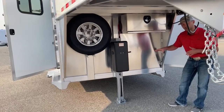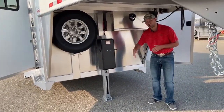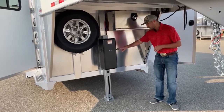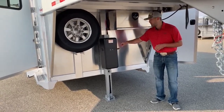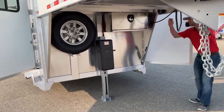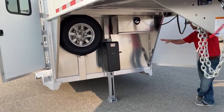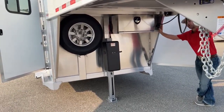If you have a manual jack at home or you're ordering a trailer and want to upgrade to a hydraulic jack, they're super simple — you hit a button and they go up and down. When we put a hydraulic jack on, we use an equalizer system that also has a manual override, so if your batteries die while you're traveling, you still have the option to jack the trailer up and down and you're not stranded.